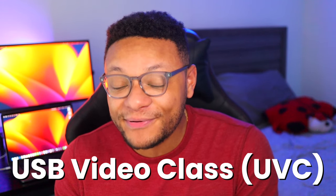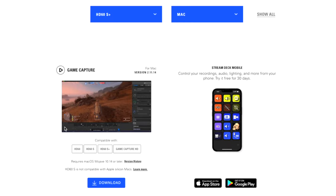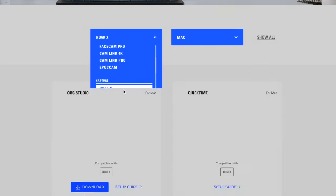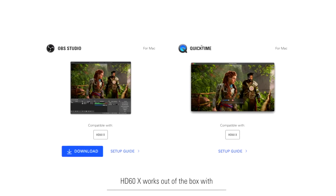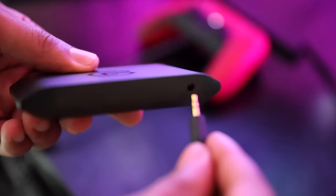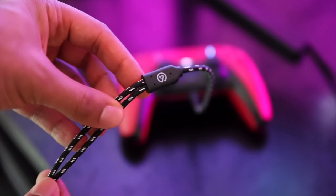One amazing thing about all of these capture cards is that they all have UVC support, which means they're going to be plug and play in your Mac, Windows, or Linux computer without having to download any specific drivers or software. For capture cards like the Elgato HD60 X or the S Plus, Elgato has their own software you can download. However, on the Elgato downloads page, the S Plus can only be used with the original game capture software on Mac for Intel chips — not Silicon M1 or M2 chips. For the HD60 X, there's no Elgato software or 4K utility tool available on any Mac, and this is a big problem for those using the Elgato Chat Link cable, as you won't be able to switch from HDMI audio to analog audio.